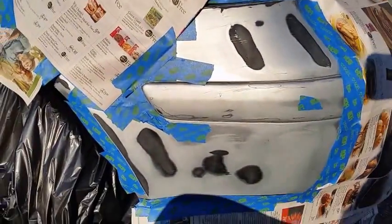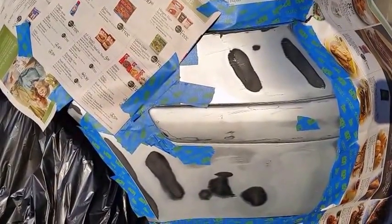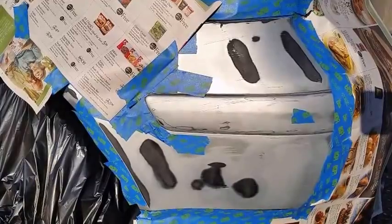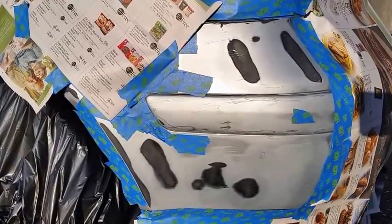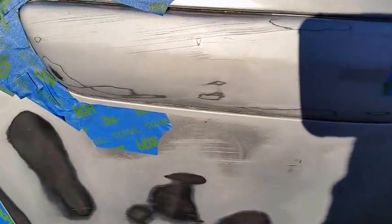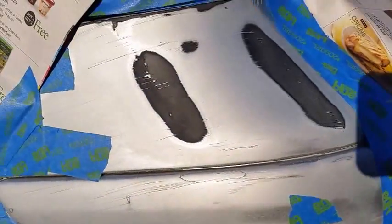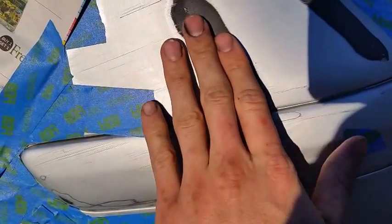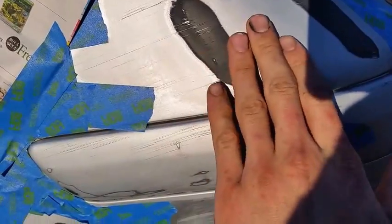My confidence here isn't at its peak. I'm not really sure exactly how much to mask, or if I should prime the whole area versus being more selective. But my rationale is there are lots of small scratches throughout that would probably be best filled by a coat of sandable primer. And through sanding afterward, I should be able to level out the difference between the deeper areas and the smoother surrounding paint. So I'm going to go ahead and put a coat of primer on all of this and let it cure overnight.